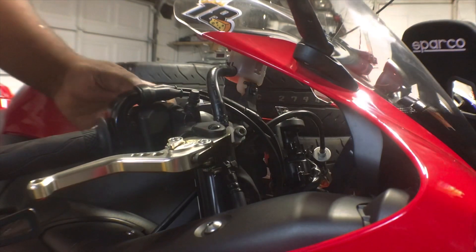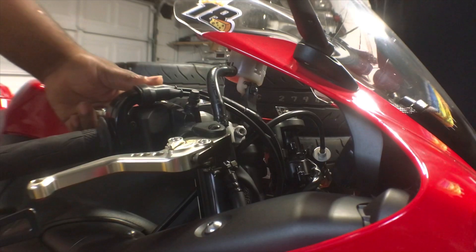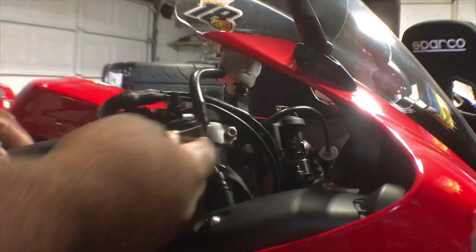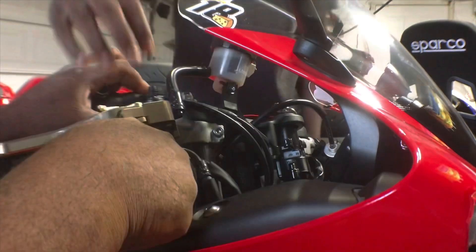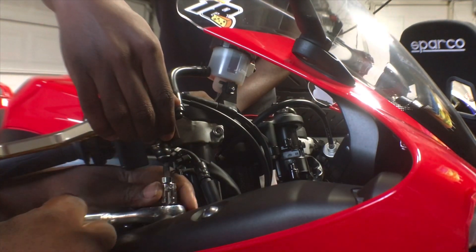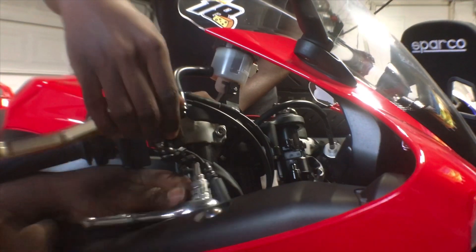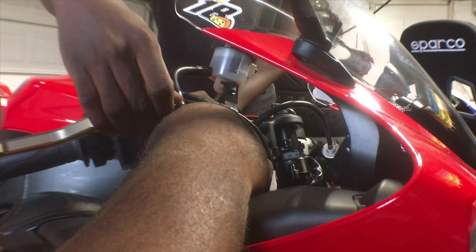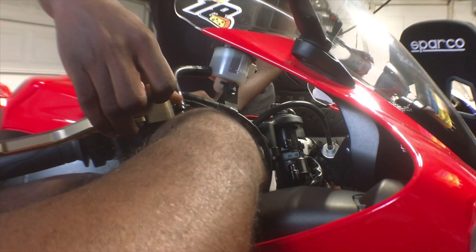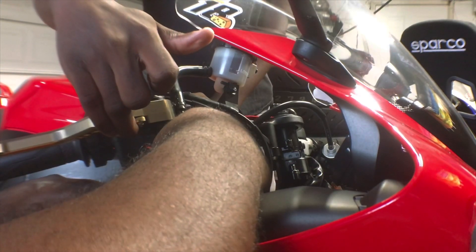So that's the plan. We're just going to loosen up the brake master so that I can freely move it around to adjust it, so that way we can move it around a little more freely. I hate doing this the way I'm doing it right now, because it is dripping, but I will pump the brakes back up here shortly.